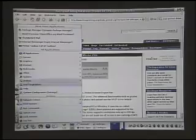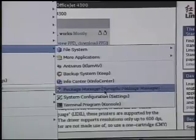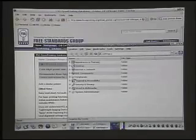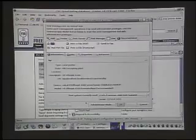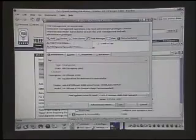Here's how I had to install the printer driver — there might be a better way, but this is the one I figured out. You go into the system and into system configuration, which brings you into all the settings for all the different hardware pieces of the system. Once in there, I chose peripherals. In the peripherals section, this is where you can set up your digital camera, your display, and also your printers. From there, you can add a printer, and from here on it's pretty much just a wizard that walks you through, allowing you to choose the correct printer driver. I didn't find an exact driver for this model, but I found a close one, installed it, and it works just fine.